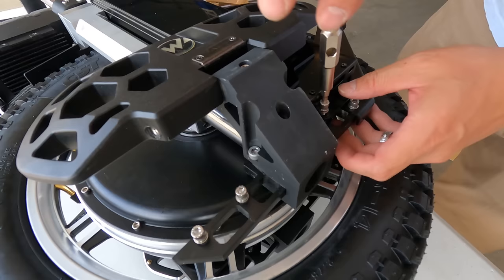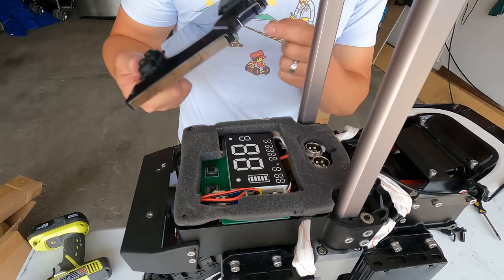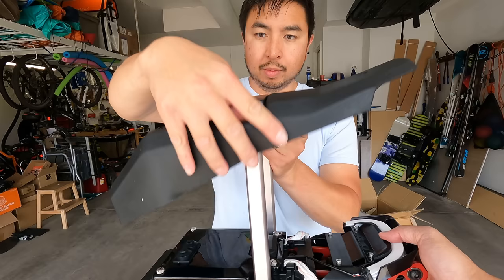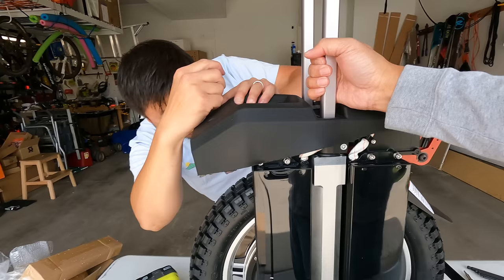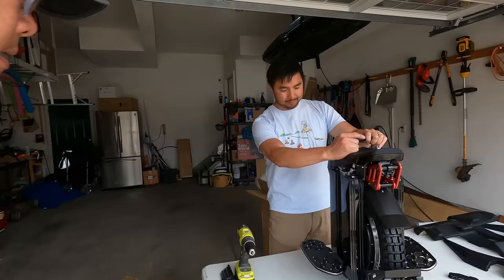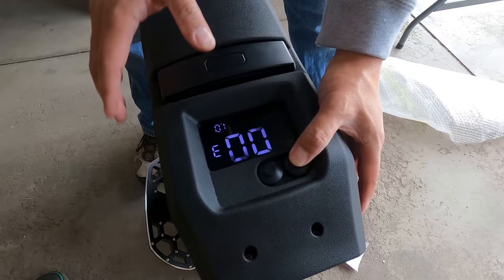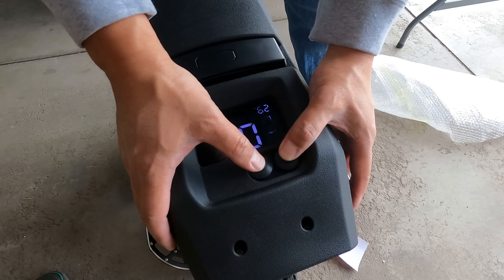There's a plastic fender here, and adjustable under here you have a metal fender. There's no speaker on this electric unicycle and there's also no USB charging. We've finished putting the batteries on but there are a couple final touches that need to be done. Let's bring it down to the ground — to get it out of transport mode, hold the cutoff switch and then press the power button five times, then turn it off, turn it back on and now you're good to go.